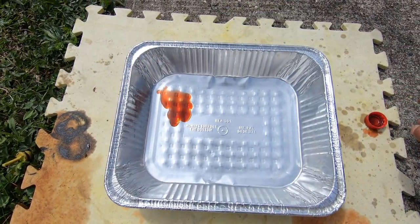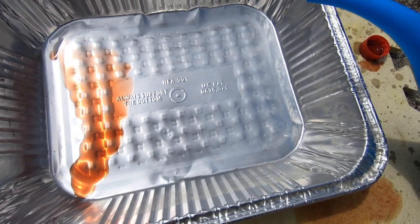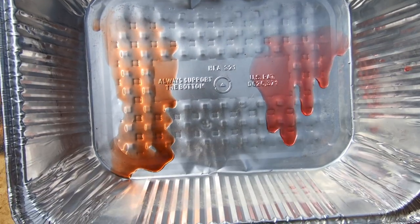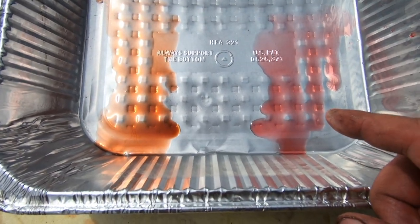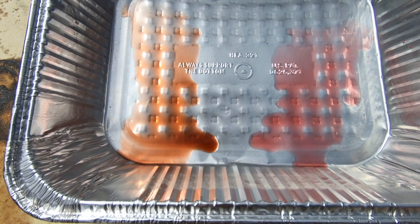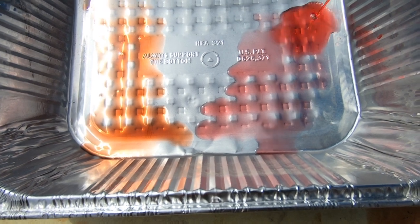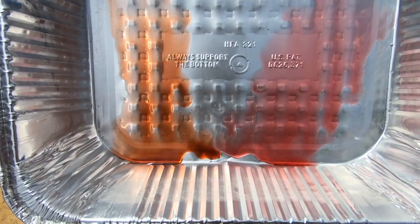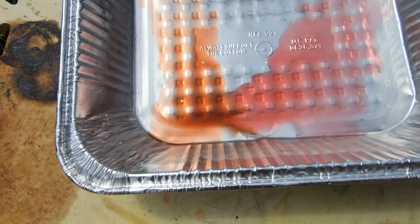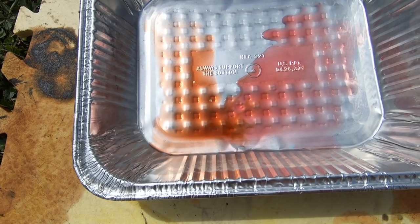I just wanted to show you guys what the original transmission fluid looks like that was in here. I don't think it has been changed because of that factory dipstick plug. I wanted to show you what clean transmission fluid looks like compared to what I pulled out of my transmission. It's reddish but kind of brown — and here's the new transmission fluid. Look at that — super pink, almost purplish looking. So this on the right is brand new Valvoline, and this brownish orange is the old, probably original fluid from my Mercury with 83,000 miles. You can see the difference. Whenever we look at our dipstick we can see the condition. If we had changed it around 60,000 miles it probably wouldn't look too different, but at 83,000 miles there you have it. Thanks for tuning in to Love What You Drive — I'll see you in the next video.